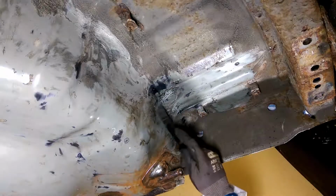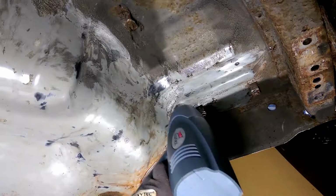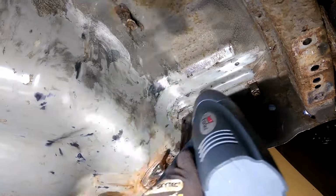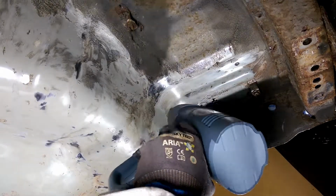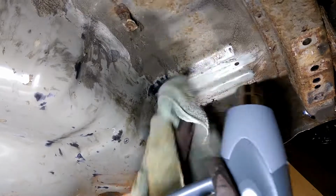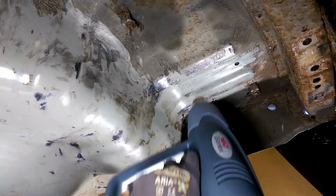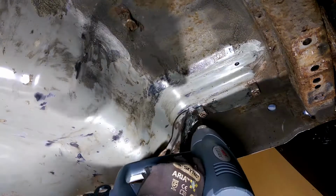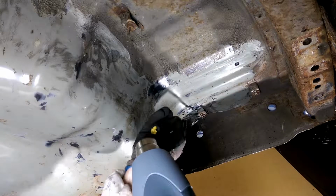As you can see, you're putting quite a bit of heat into it to scrape it off. I'm using a small bladed screwdriver, so it does take it off quite well, but it takes a long time, and you're introducing heat into the panel. So there's a little bit of a risk of distortion. Plus, as you'll see later, you'll get smoke. I think you can see a bit of smoke billowing. Yay, there you go. So there's the risk of fire as well.